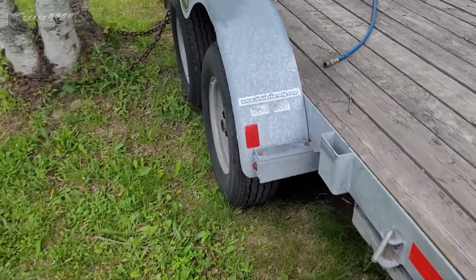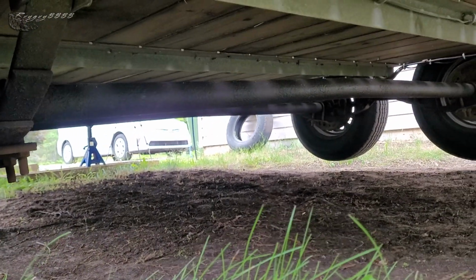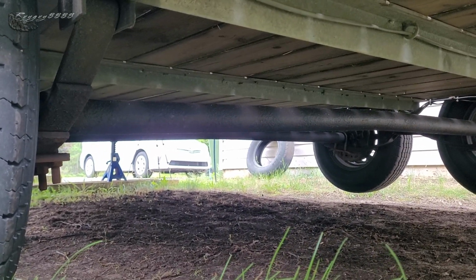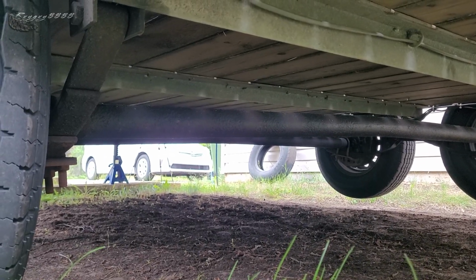So I first thought, okay, maybe I bent the axle. Well, I kind of did. The bend in the axles upwards that you see in here, with pretty much any trailer, is right. That's what you want. As weight goes on the trailer, those axles actually straighten out. But here's my problem. Get down on the ground in the ants.